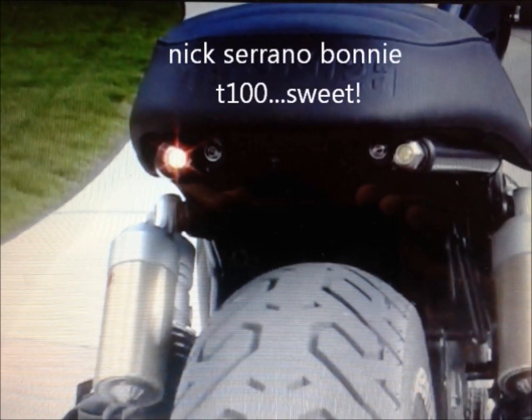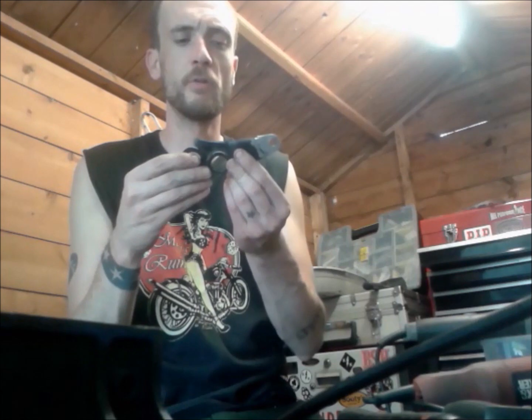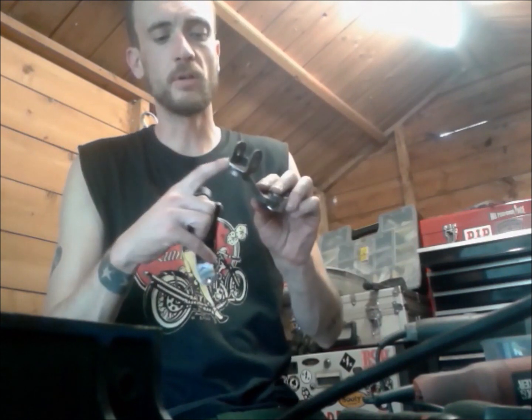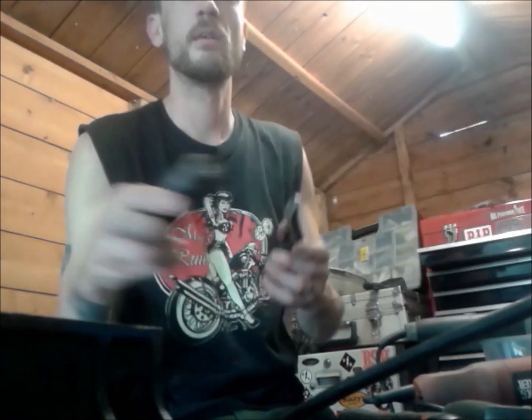Not sure about the flat bars yet, but I was thinking about the little projector indicators, and I've always fancied mounting them at the frame rails. There are two plastic bungs in the back of the frame rails you can pop out - that'd be a good place to put the indicators. I'll probably use the egg indicators off the Bonneville on this project. In the meantime, I've got the foot peg bracket - chopped all the tabs off, sanded it, ground it all down, drilled a hole through, so I'm going to fit the stump pegs on there.